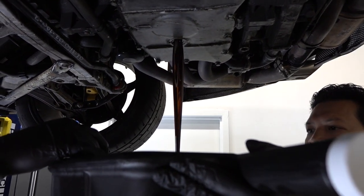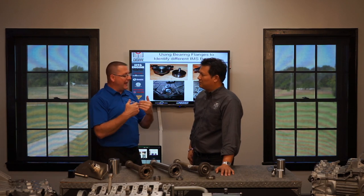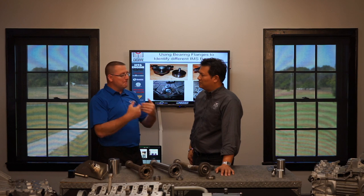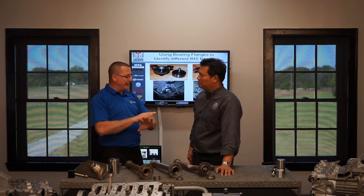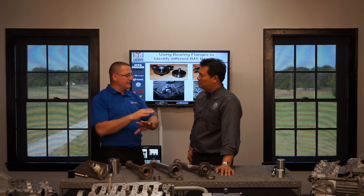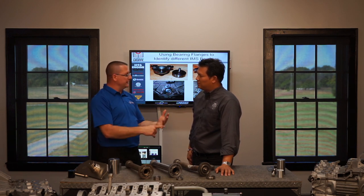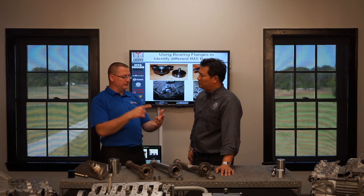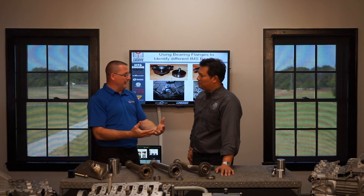When I say frequently, I'm not talking about in miles. Even my customers that purchase engines from me — I had to constantly keep them aware: my service interval is every six months or 5,000 miles. It doesn't matter what the owner's manual says anymore. I've kind of reconstructed this into my own best practice, and I know from my trend data, my used oil analysis, and direct experience when we start to see oil degrade.